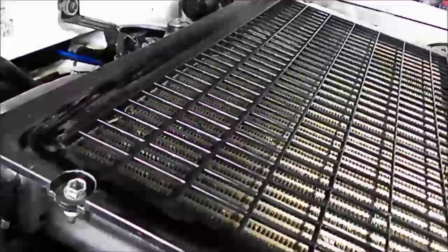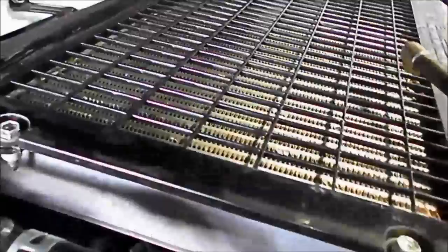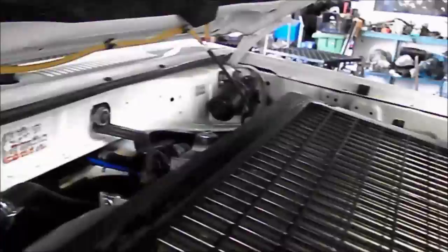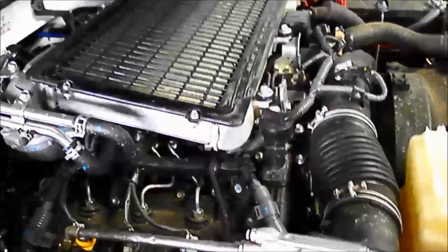When you're blowing out the intercooler, instead of blowing straight down — which would push the debris straight into the cooler — what I actually do is go on a bit of an angle so the air actually hits the flat bits in there and throws out whatever's in there instead of pushing it straight in. You'll see it's working out a bit of stuff. You might have to pull some of it out by hand — there are a few sticks and leaves in there that won't wriggle out. We'll finish that off and then fill it up with oil.